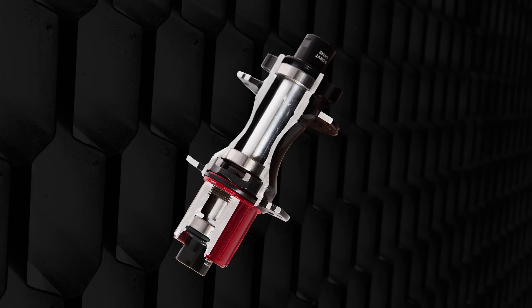If you look at the structure of a hub, you've basically got the shell, the cassette mechanism, and normally four bearings with the axle running through it. Really the only thing that could go wrong would be the bearings collapsing, and that would only happen if your bearings are in bad condition to start with. Even if they did collapse, the axle is still going to continue rotating around on the inside.